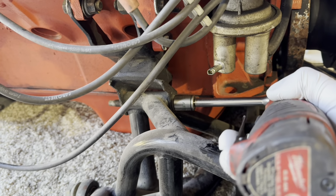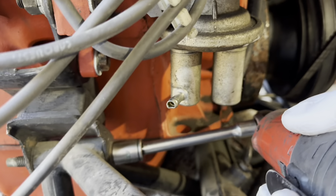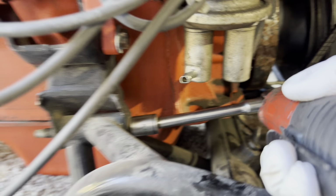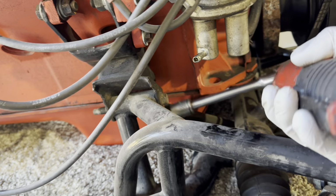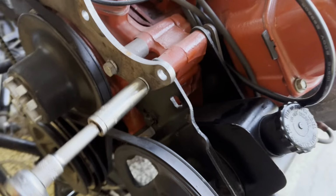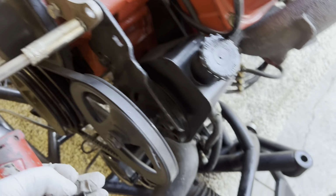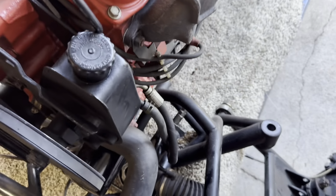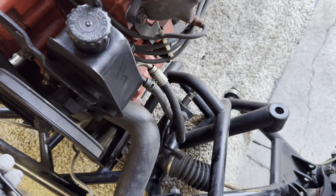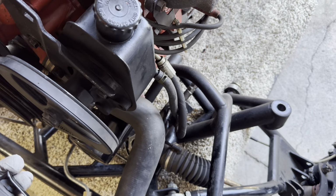Remember when I said don't forget the motor mount bolts? Yeah, don't forget the motor mount bolts. Also, that's kind of weird. Fuel pump line's dented. Yeah, I can't do this while filming. Okay, so everything on here is way over torqued, which, I mean, okay, it's not gonna fall off, but yeah, we did forget the power steering, so it's all hooked up to the K-member. So what we're gonna do is just take the pump off, and then we'll drain this later on the ground so we don't make a giant mess everywhere.